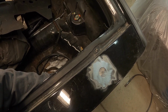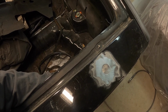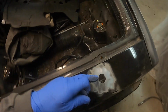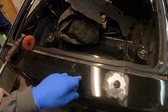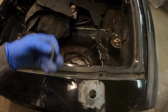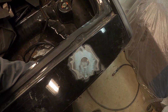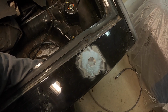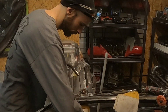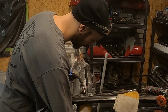You're not putting really much extra. You're gonna have to put the same amount of mud no matter what. Because chances are, when you weld this in, we're gonna have to weld it very slowly, because this tailgate is like a Pepsi can. It's very thin. So we'll have to be very careful not to make more work. So I'm just basically gonna use a magnet to hold that like that, and weld her in, and then, all right, no going back now.